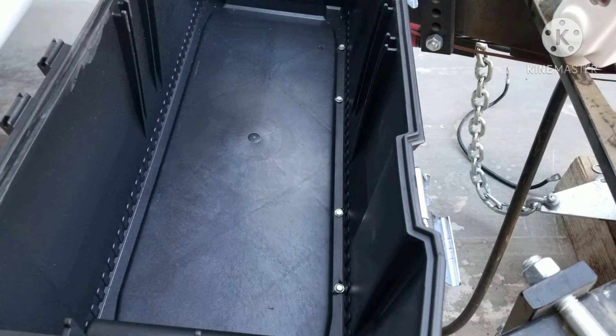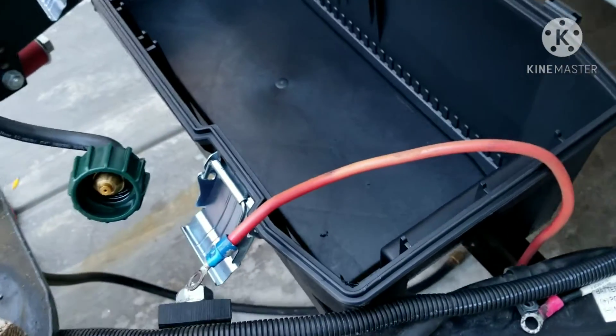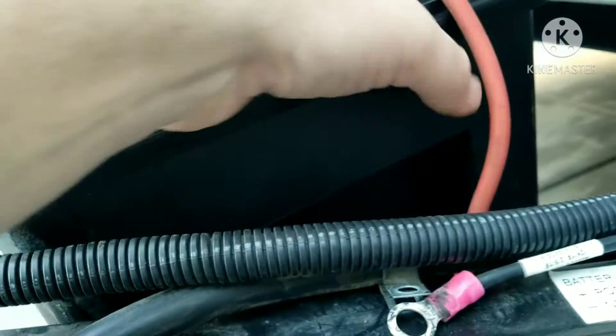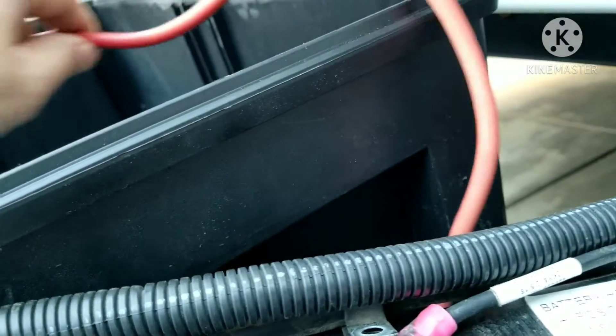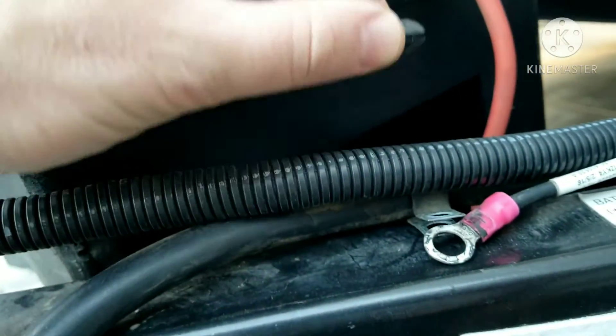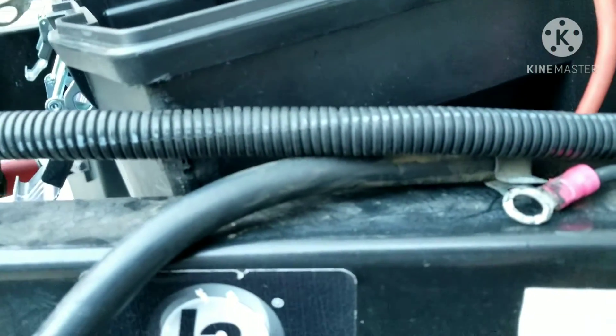After pre-fitting, I used the existing mounting screws that were holding the other two battery boxes. There are also a couple of extra holes used for drainage. Now I'm running the positive and negative cables — I'll drill two holes, one for each — and I'll drill a third hole later when I hook up my solar panels to run a line from the charge controller.